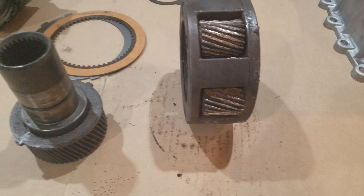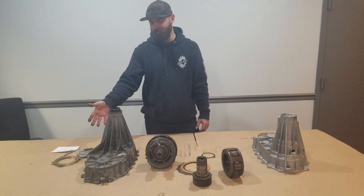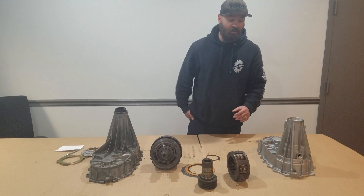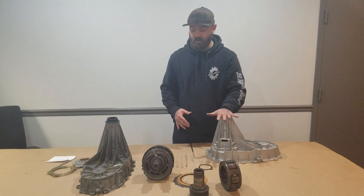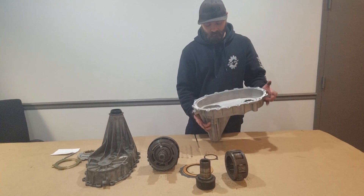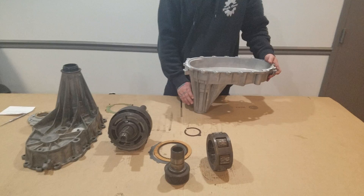If you're lucky enough to have caught your transfer case before it has any pinholes, then you can put that pump plate — case saver plate — in there and it will stop the problem. However, if you are having it rebuilt, what we do at High Gear is we put a brand new rear case half made out of aluminum, not magnesium, on every one, and we also put that pump plate in there. This aluminum is much tougher than the magnesium, and this pump plate is going to completely fix that problem.